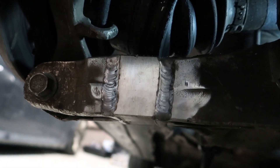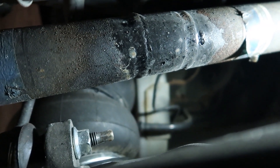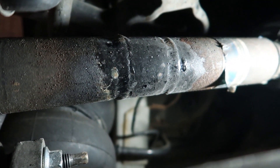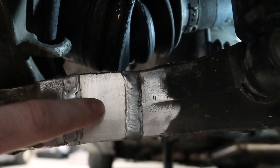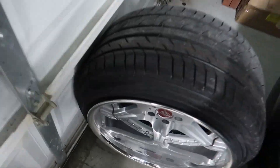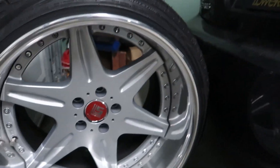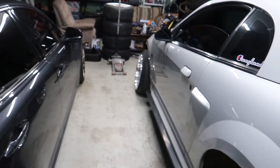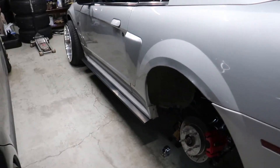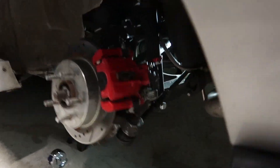Let's go over some specs. The spacer in the axle I cut at roughly one and a half inches with 45-degree chamfers on either end — a one-and-a-half-inch spacer to keep the axle play, make sure it still rotates properly and doesn't come out of the spline in the diff or knuckle. The control arm block was 1.7 inches on either end, which gave me roughly negative 12 degrees of camber aired out. My wheels are 19 by 13 inches wide in the rear, with a five-and-a-half-inch lip and a seven-and-a-half-inch barrel on the inside.